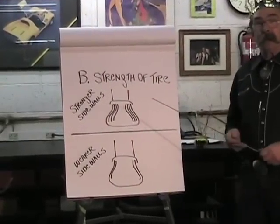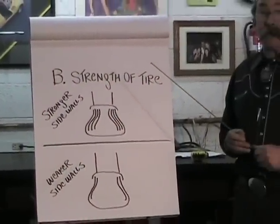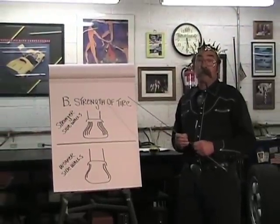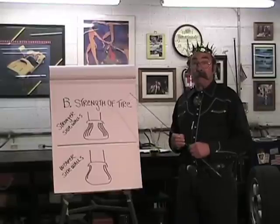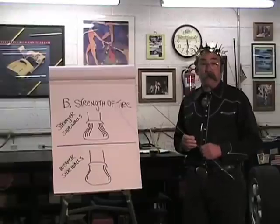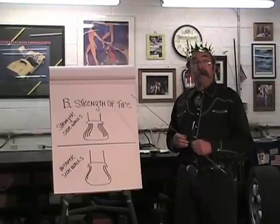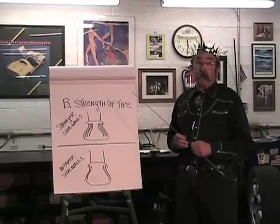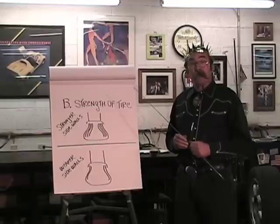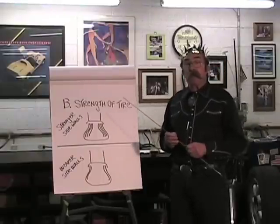One of the key things about the Mazda Miata is rotational weight — that wheel and tire combo going round and round. When engineers first produced the Mazda Miata, they found the vehicle had an inherent shake at 65 miles an hour. Over time they realized they needed to create some lightweight rims, which they did with Enkei, and they asked Pirelli to make some lightweight tires for them. That's how they solved the 65 mph shake on the first production Mazda Miatas.